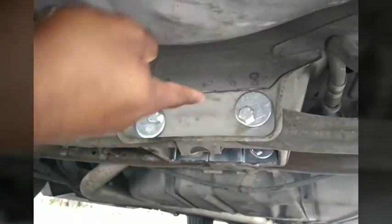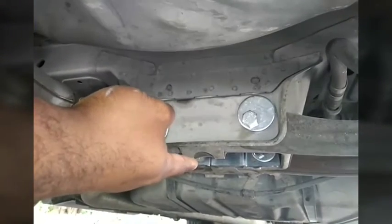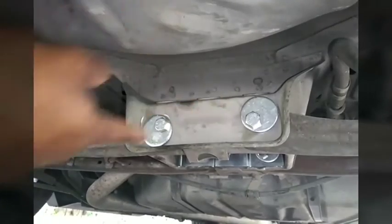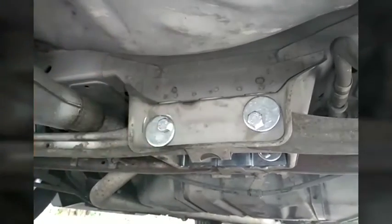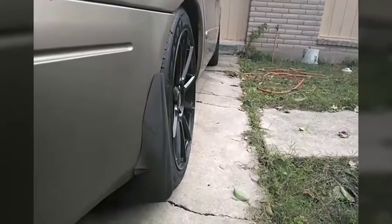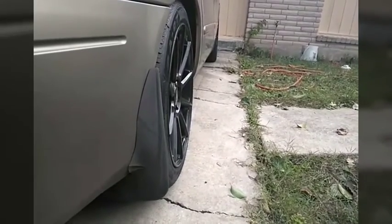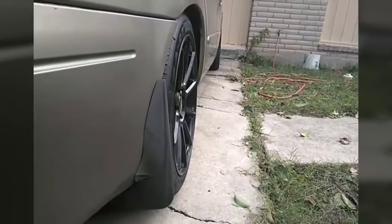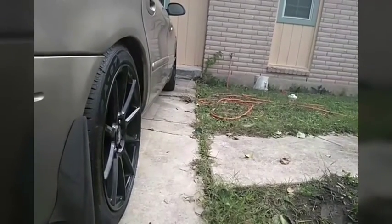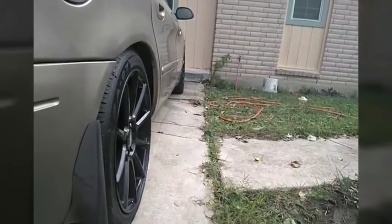This front one is for the toe of the alignment, and the kit in the back is for the camber, so I can adjust those independently. I had everything set at zero to start, so the wheels in the back looked straight up and down. From the back you can see there is no excessive negative camber — it is set at half a degree negative camber, which is within spec for maximum tire wear and proper handling. In the front there is no negative camber either; there's about a half degree of positive camber, which is in spec for what the car came with originally.